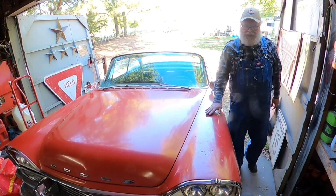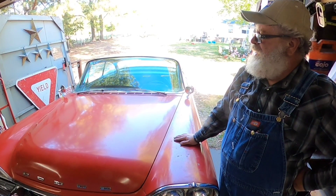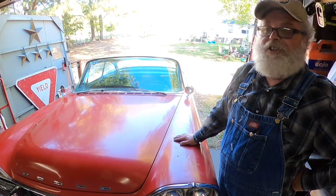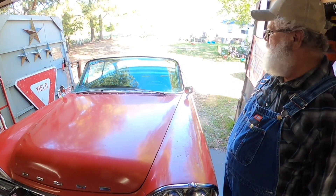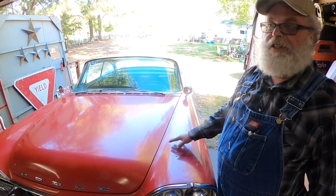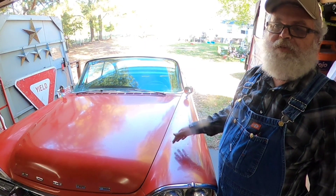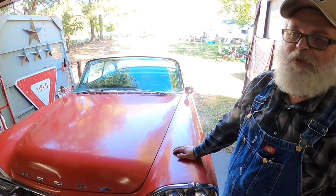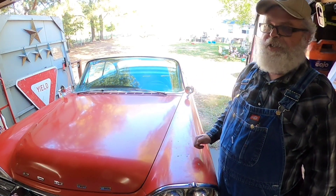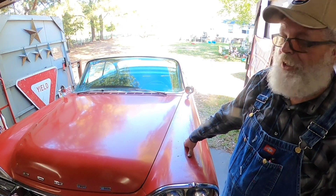Went down the road and it worked pretty good. It's not spark knocking, got a little bit of throttle response even though it's at 50 degrees — it still runs good, a little peppy. It's not jumping off the line peppy, but it's a big car. I'm going to try that for a little bit and see how it works. I'm going to change the plugs once it cools off and get a plug reading, and I'll follow up with a video. When I go to set the carburetor, I'll let you know how the timing worked out — because setting the carburetor, you've got to get your timing set first, and then go to the carburetor. We'll travel around a little bit like that, see what happens, and thanks for watching.